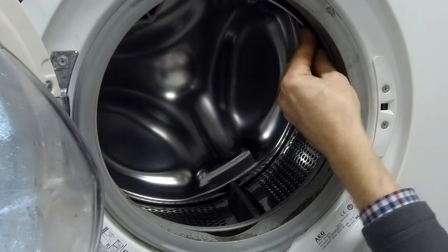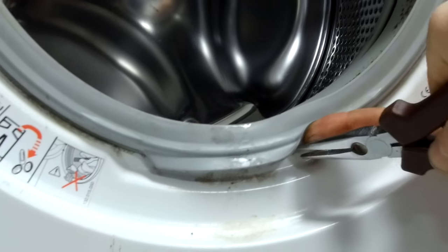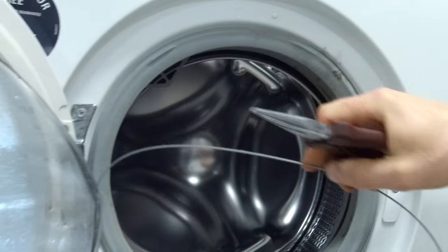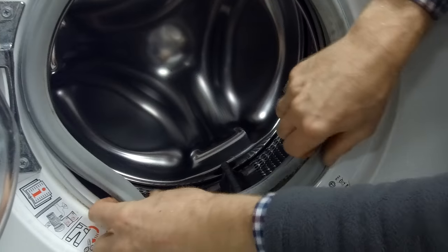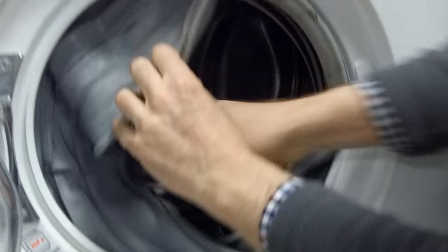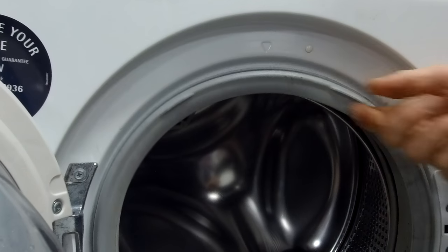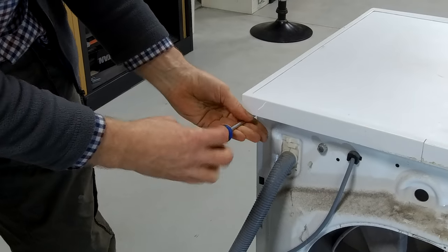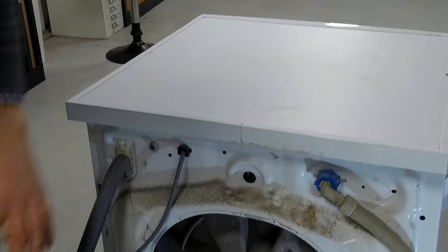Right, let's have a look then. Maybe we've got to take the front seal off. In order to get this drum out, we're going to have to take this rubber seal off. Apparently some of them have got interlocking, but these AEGs have got what looks like a spring, so I'm hoping I can get that with these little pliers. That ain't too bad. There you go — that's that out. It is grimy. Has it got another spring on the top? It looks like something else has gone — as I look in by that seal, something else's happened because the bearing — there's no sign of rust there, so that bearing, I think, is all right.